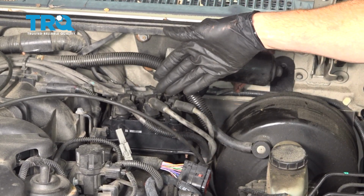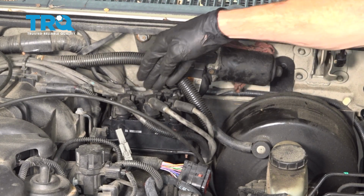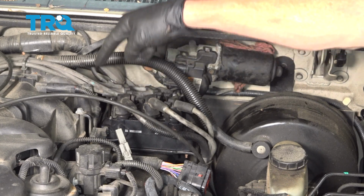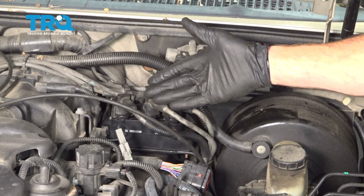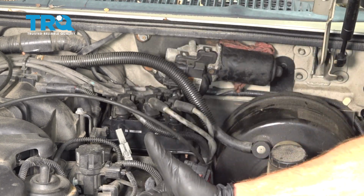Now at this point, you just want to double check each one of the wires. Make sure they're completely secured all the way around. We know that we torqued all of our mounting bolts. After that, go ahead and start it up. Make sure you don't have a check engine light. Take it for a road test. Thanks for watching.